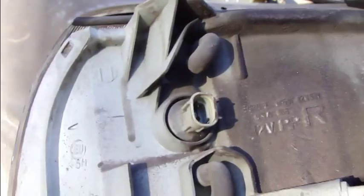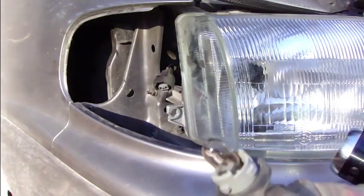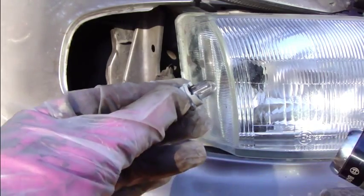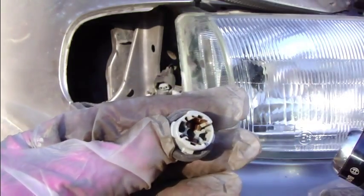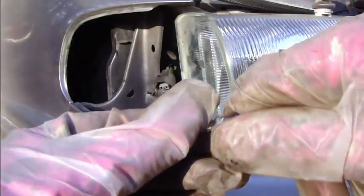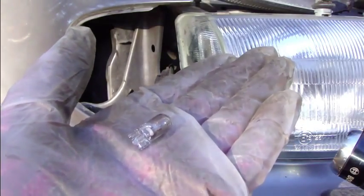And here was this cover, and on the cover's other area, when we rotate, there is the bulb, and the idea is that when I rotate it in this way, the bulb opens. Yes, it is in there. And there is the bulb, and when we change it, I take my fingers in here and pull out the bulb this way. There is this area where the new bulb goes, and the bulb size is important, it's 5 watts, and the voltage is 12 volts.